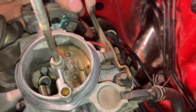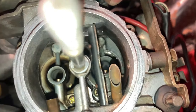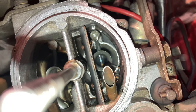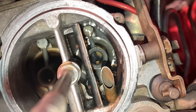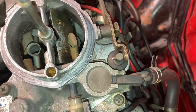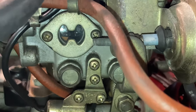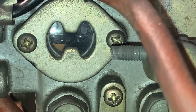If the engine is fully warmed up, this choke valve will be open like this. If we look down in there, you can see whenever I open up the throttle, there's a spray of fuel coming out of that little nozzle there — and that is a result of this accelerator pump. So we can verify that is working.